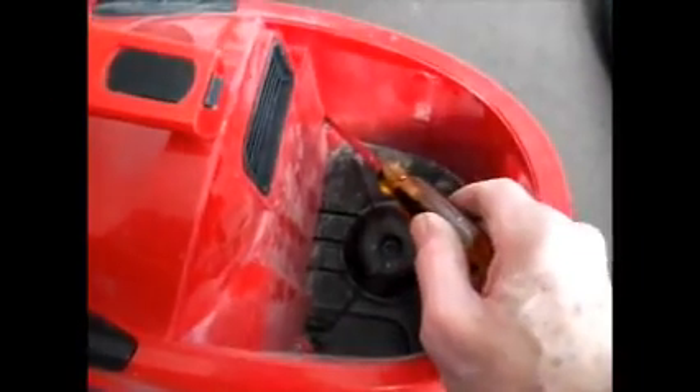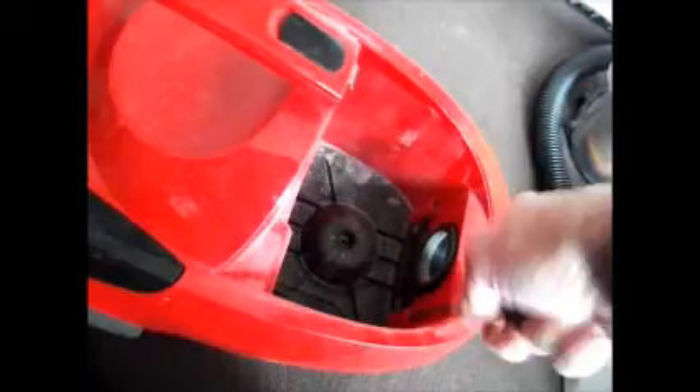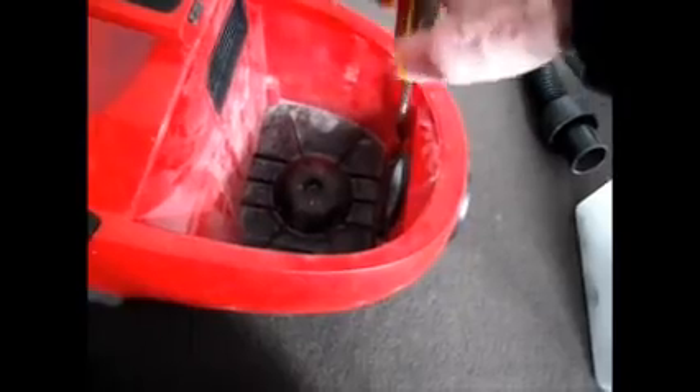So the next thing we're going to do is take the body off. We're going to start by removing one, two, three, four screws. These are Phillips screws and they're not too tight. And when you put these vacuum cleaners back together, be sure that you don't over-tighten these screws because once the thread's gone... So just to get things out of the way, we'll remove this exhaust filter cover.